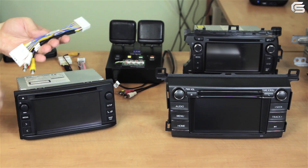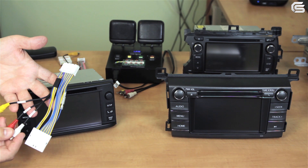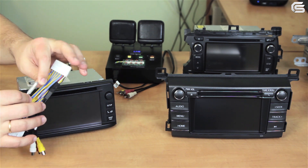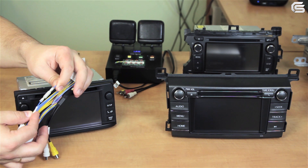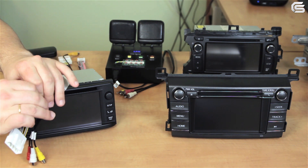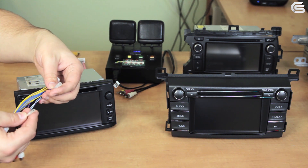As described before, we have a cable like this. It has a yellow RCA for video and red and white ones for audio input. There is also an SPD or speed cable that can be separated. This wire is basically a switch enabling the video to play while the car is in motion — also called video in motion. It can be disconnected and it has insulated ends, which means you can leave it disconnected without any worry of a short.